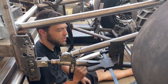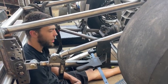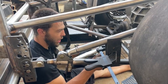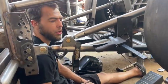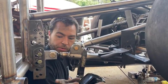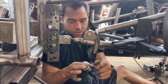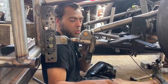You can either do a wishbone — generally has two points on the rear end and a single point on the chassis, or two points on the chassis and a single point on the rear end. If you're doing a wishbone, you want your heim joints either vertical or horizontal, but you want your single joint operating ideally horizontally to handle the side load. A heim joint is designed to work in two planes but not necessarily the third — there's not a lot of movement there.